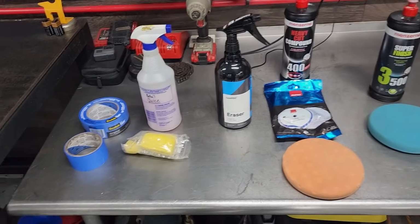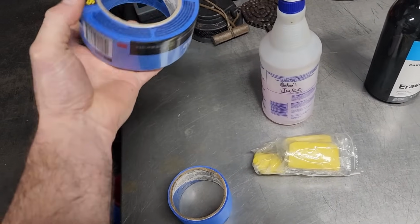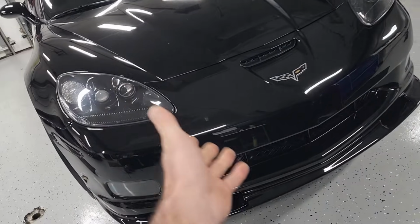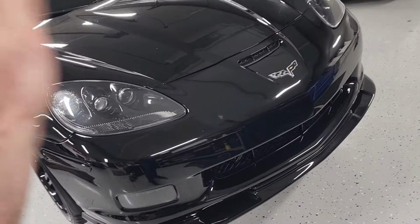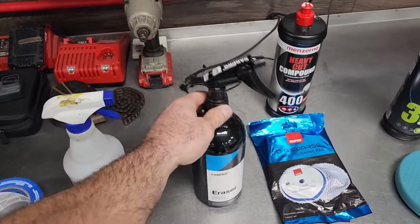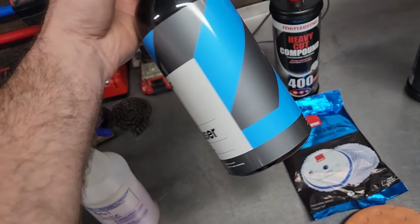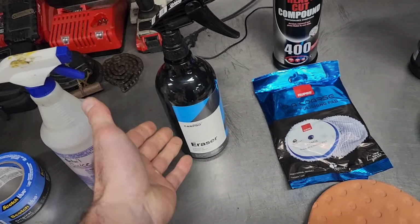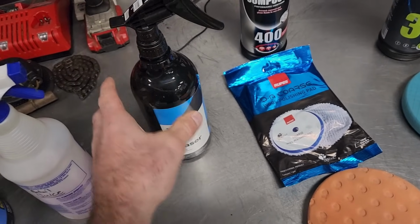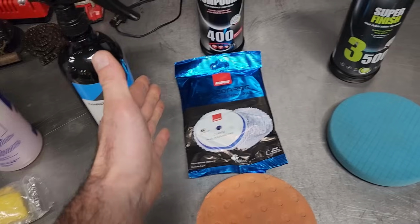So here's my supplies out on the bench. First things first, we are going to tape off any weather stripping or seals or anything that we don't want to get all of our compounds on. Next thing is we're going to clay bar the paint. That's going to remove any contaminants that are right on the surface or embedded in the clear coat, sap, dirt, debris, anything like that. Get us ready for our polishing stage. Then we're going to decontaminate and clean all of the paint with, in this case, CarPro Eraser. I've just had this stuff forever. Some people use an isopropyl alcohol dilution mix. Some people use a Prep-All wax and grease remover. Basically, you want to get the paint down to zero. No waxes, no nothing, no sealants on it,